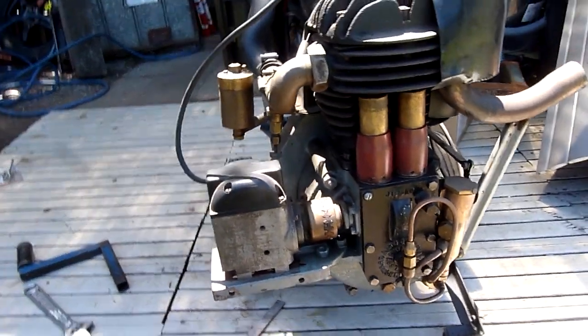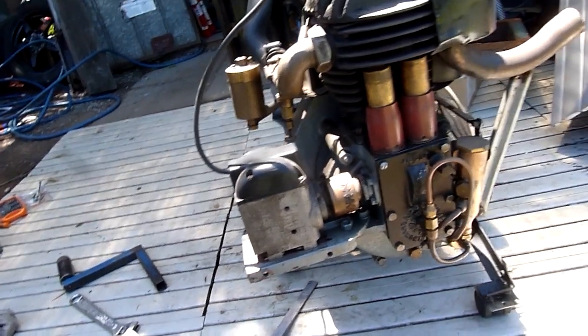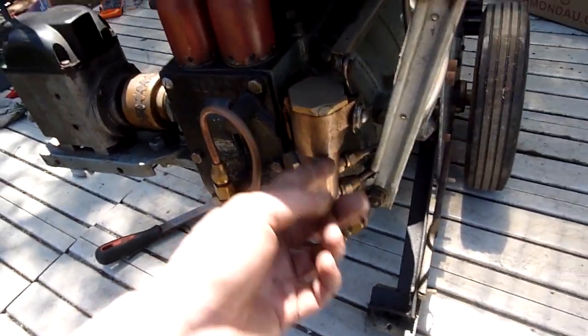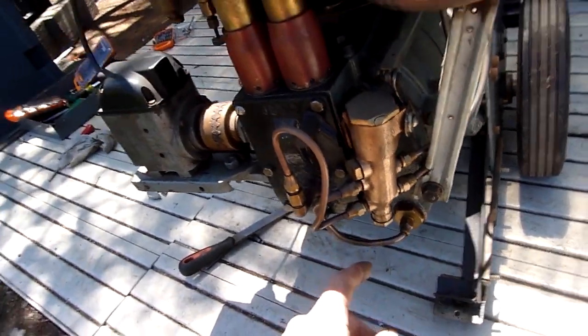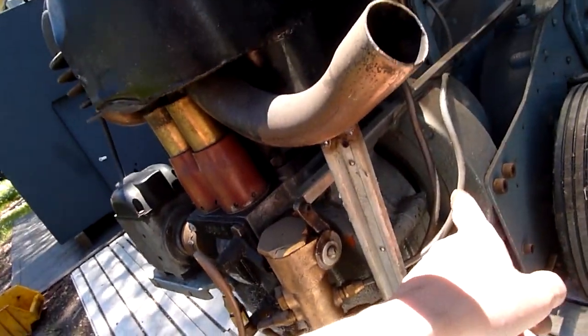And it's based on a 19s or 20s Sturmey Archer dry sump engine. You've got lubricating oil up here and an oil pump. That's the oil pump. Crank feed, scavenge with a strainer in the bottom of the sump. Scavenge to pump and return to tank.